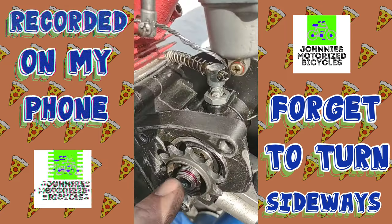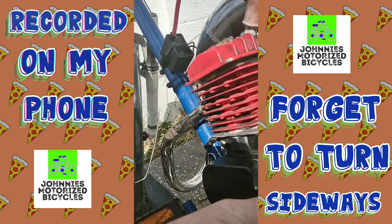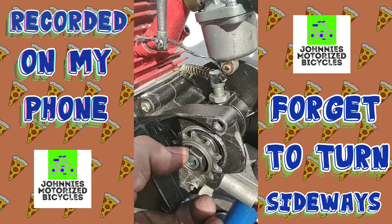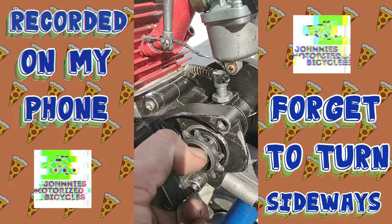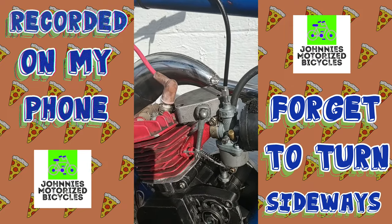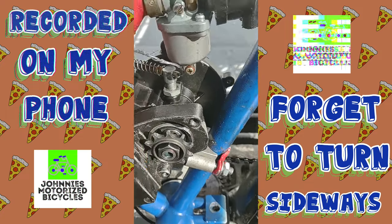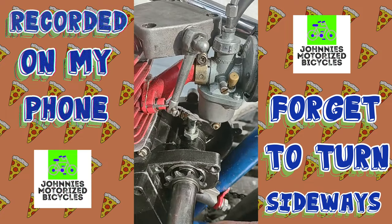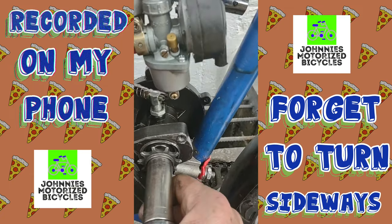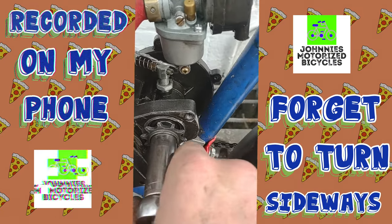Together, I am putting a little bit of red thread locker on here. Not a lot, but a dab. I don't recommend that for everybody. However, I have been having nothing but issues with this backing off, and it is removable. I don't want to use the blue because that's really removable. The red's much harder, but totally doable, so I want to put it on there, keep it from backing off. It's not like every day I need to get into this clutch, but lately it's been every day because it keeps coming apart, so I want to make sure it's not coming apart anymore.